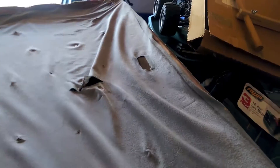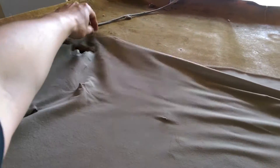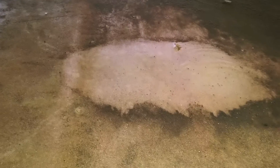Before you totally get rid of all the cloth, make sure to check where the holes are cut out. On older models you probably won't have to worry — basically everything that's got a hole, you'll make a hole. For newer ones with different holes for different upgrades and accessories, make sure you remember which ones are cut out and which aren't — you don't want to be cutting holes in things you don't actually have. Also look for any overlapped areas; the only one I'm seeing right now is the front, so you want to leave a little extra at the front when you cut to length. Now get yourself a brush and go to town — your main goal is to get all the old foam off, everything that's loose, so that the headliner board is clean and ready for sticky stuff.